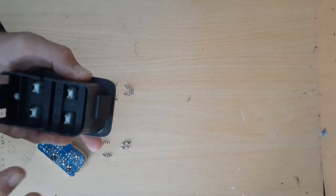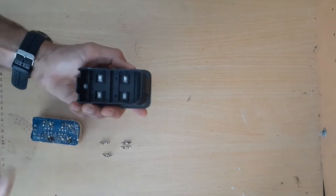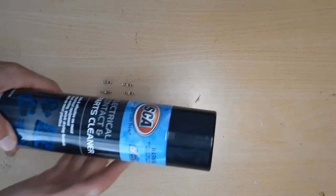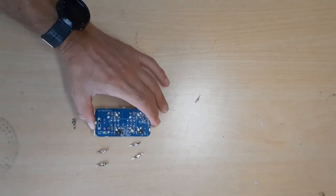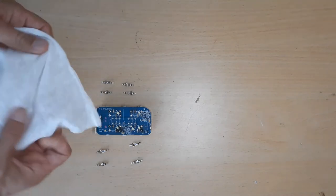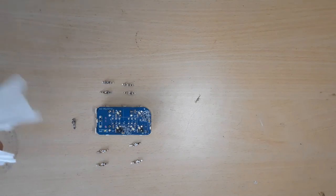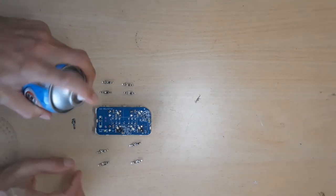It just puts pressure on the contacts around it — either direction — and makes electrical contact. I have the electrical contact cleaner now. I'll give it a bit of a spray and try to get out some of the markings and bits and pieces on all the contacts, and then hopefully put it together okay. I've got a lint-free clean rag that I'll use with that, maybe wrapped around a screwdriver. I'll get them underneath as well — the contacts on the top and bottom.